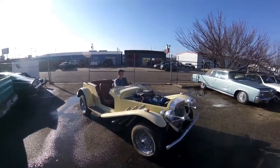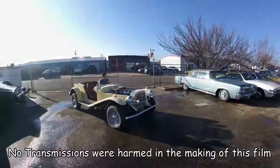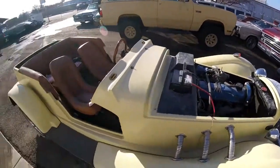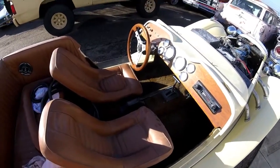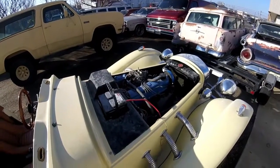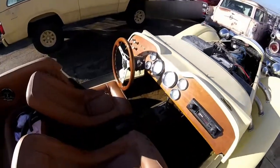She's working better. I don't like doing that to this transmission, but the alternative is to pull it out and rebuild it. If it has to be pulled out and rebuilt, we might as well give it every chance to work - and I think it'll be alright now. It's smoking because we put gas in the oil since this engine sat forever since the 80s and was rebuilt but never run. Hopefully it was just rebuilt with oil and doesn't have ruined assembly lube in it, but if it does we'll know when it starts rod knocking.